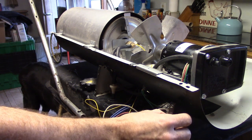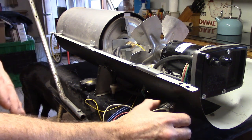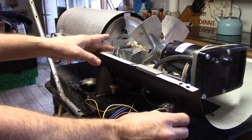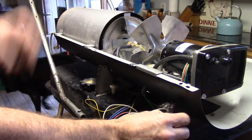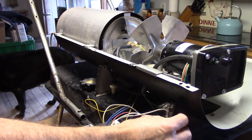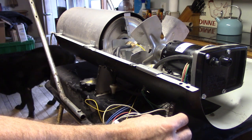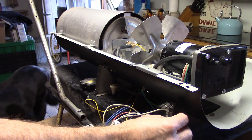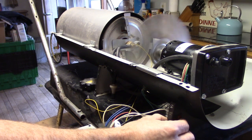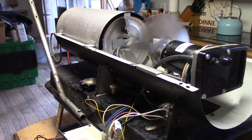Since I've admitted my mistake, let's turn this back on again and see what happens. You turn the switch on, the igniter glows for five seconds, and then the fan kicks on. And there we go — it did light.